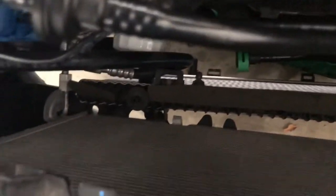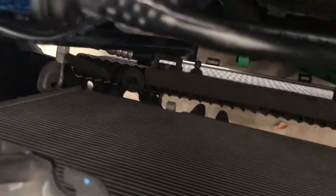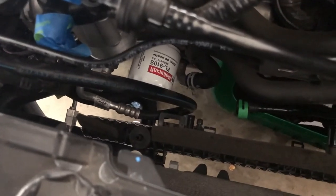The tabs are right here — it's a little clip kind of like up top. You pull the plastic back and release it from the AC condenser on both sides. You're going to have to pull the radiator up above the condenser a little to release the top. With the condenser free, you can lower the radiator down. Watch out for the condenser — the fins seem a little more durable than the radiator, but barely. You have some fun with the AC lines, but you can get it out.